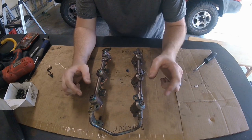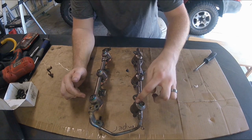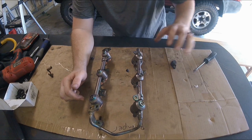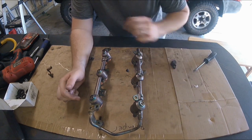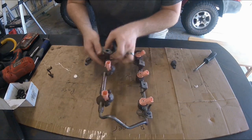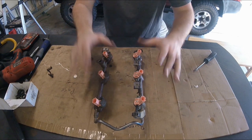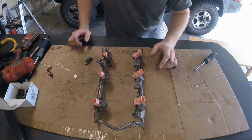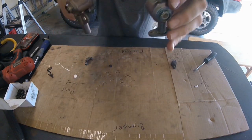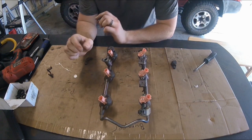On the flip side of the fuel rail, the bucket feature has a little bit of a nozzle where the nozzle of the fuel injector mates to. There's a rubber washer that seals around the outside and that seals to your lower intake manifold - it's an air seal preventing outside air from getting inside that manifold. If you need to remove the fuel rail, you can rebuild or replace a fuel injector without removing the entire rail, but if you do need to remove the rail, it's really just four bolts holding it in - there are little flanges with bolt hole locations.